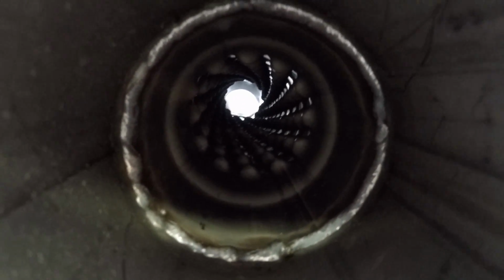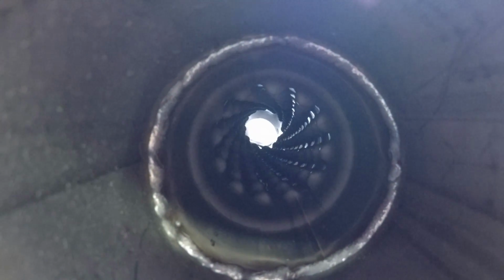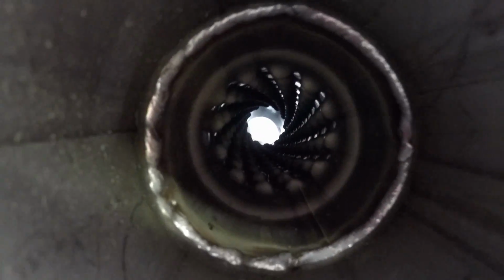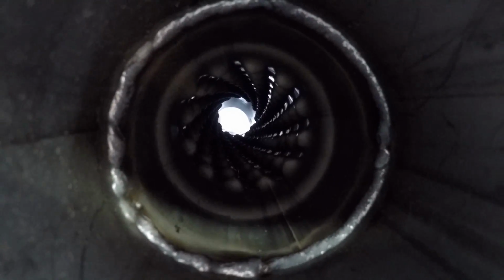Now, Stainless Works, this is a full 3-inch pipe, but as you may have saw when I looked down there before, you'll see they actually have some technology in there. That is a 2.5-inch pipe welded in there that, I guess you can kind of say, massages the tone of the exhaust. I don't know for sure what their official naming is here, but from my understanding, this helps prevent drone and provides a slightly different tone to the exhaust that is unique to Stainless Works. Kind of cool, interesting technology. From what I also understand, you can also order this XPipe without that in there. You can just get a straight XPipe and not have to worry about that 2.5-inch piece that's in there.